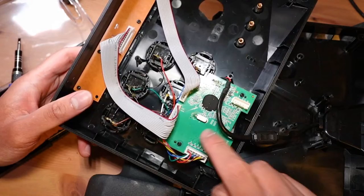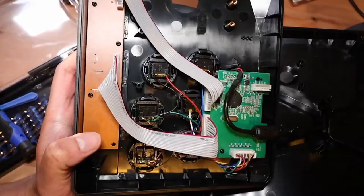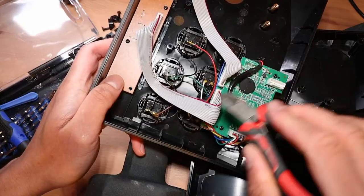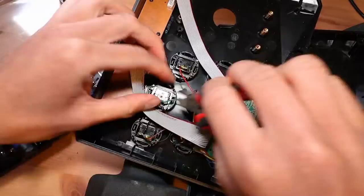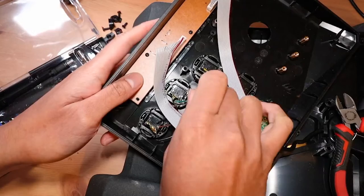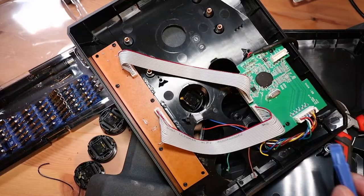I'm going to leave the PCB in here but I want to remove the buttons. I'm not sure the best way to do this — I might end up rewiring with completely new cable, or we can cut the wires off the buttons, which is a bit more destructive but if you're not going to use these anyway there's no need to keep them soldered. They have daisy-chained all the black grounds for all the buttons, with only one ground at the very end. I've just finished cutting off all the wires. I'm going to use my spudger to pop the buttons out.